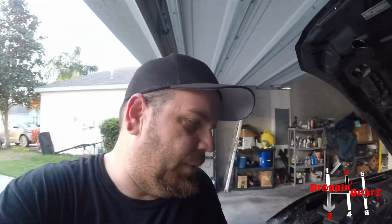So I had to make that, and on the passenger side, I had to move the starter cable up and add a couple of washers to the actual starter, because these have starter cables with little locking pins. So I'd add a couple of washers, move the starter cable up, and tighten it really good. Make sure that starter cable never moves, just to be able to fit an air filter in there. I had to do the same thing with the tube. It was difficult to the point where I was like, what the hell did I get into? Because simple things like an air filter became difficult. But I figured it out.